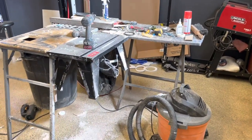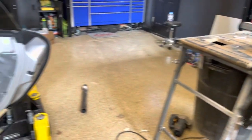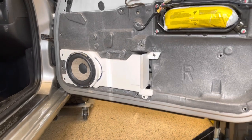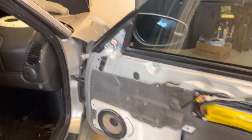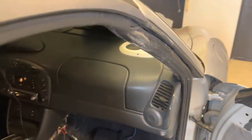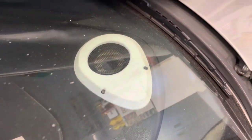As I close out today, I'm going to be doing some cleaning here, which you guys don't need to hang around for. But let me give you a shot of the car. I put my baffle in so you guys can see exactly what it looks like installed. More than likely I will paint it black and I got some Dynamat to go over the top of it to stop it from resonating. The dash is complete as far as the mock-up goes. I like it. I may have to wrap it in Alcantara just to see how it looks. Not a hundred percent sure if I think it's too high or not. The beautiful part about those templates and my router table is I can go ahead and remake them in quarter inch and see which ones I like better. My full Focal logo on the grill there is exactly the look I was going for.